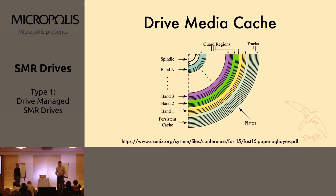SMR drives have something fundamentally new that hard drives didn't used to have: they now have state. Imagine you're writing to one of these drive-managed SMR drives — the drive is making a translation between how we used to talk to drives and this SMR way. It now keeps track of what is living where on the hard drive. Basically it maintains a map of when data is written, finding the appropriate SMR track, writing it there, and remembering where the write pointer is.